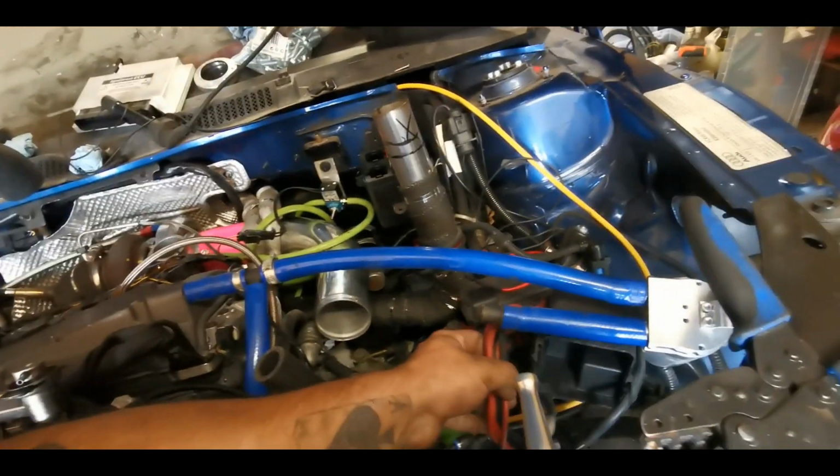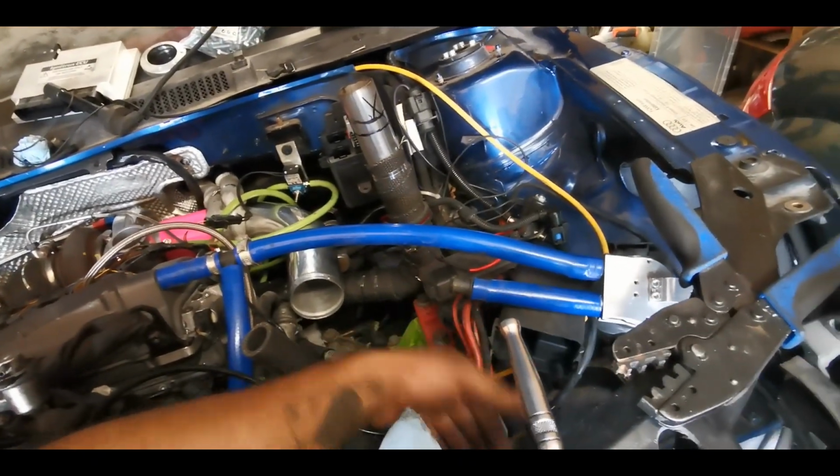And that's all I need to do for first start, I think. It's just going to spur me in the right direction to actually get this thing finished. So yeah, I'm going to install a few bits. I've just got to drop a fuel pump in the tank, download the software for Ignitron, and connect a battery up somehow, because I've not put the connectors on for the new race battery yet. So connect the battery up, and that's it really. I can turn the key and see what happens.